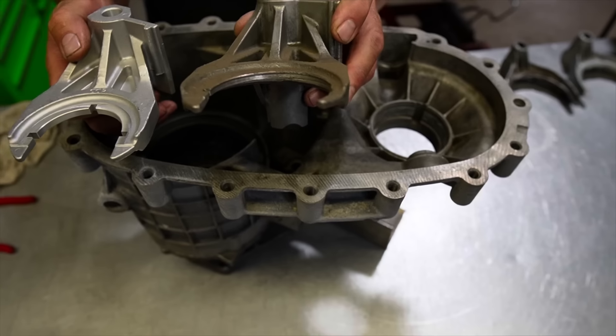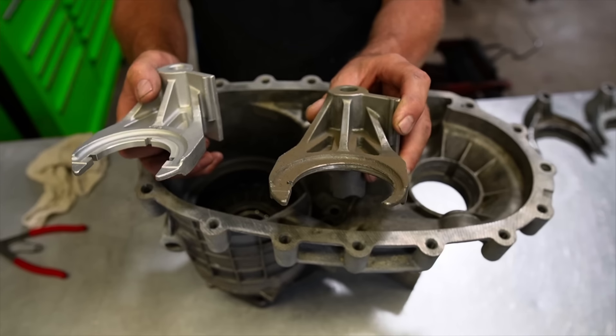I've read on some Facebook pages some pretty bad information — guys saying 'just put a new fork in, the fork's junk.' But there's a reason why the fork failed and why the pad failed. It failed because the bearing is walking backwards and the range hub is coming back with it, putting pressure on and burning it up. When these bearing bores get bad, you end up with a fork that looks completely burned out — the entire center burned out. That's what you end up with if you don't address the root cause.